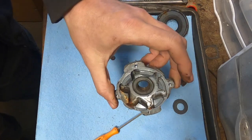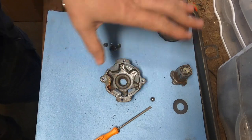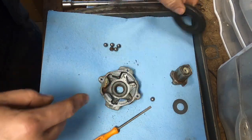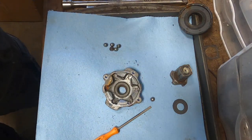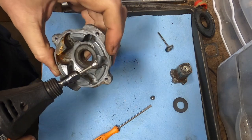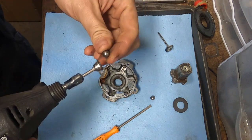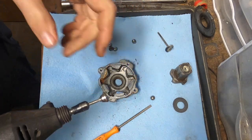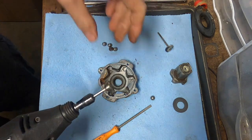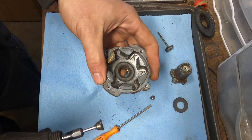There's a little washer in there we're going to take care of. This is almost completely solid metal except for the gunk. If you want, you can use carb cleaner or brake cleaner — that's fine. Don't worry about ruining any rubber material; get this out of the way though because the top is rubber in most cases. For these really small areas I like to use this little brush — it's the perfect size for fitting into little crevices. You can also do that to the ball bearings. Make sure you're wearing glasses — this brush shoots hairs everywhere like a golden retriever of Dremel bristle brushes.